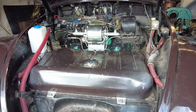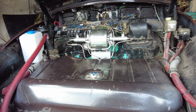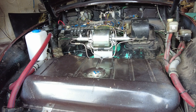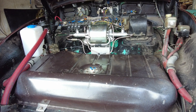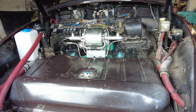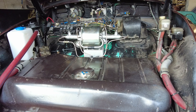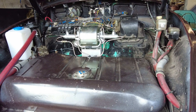We are all back together again. I just jumped in and started it up. We tested we got a vacuum first, which we do, and my foot went straight to the floor - there was absolutely nothing there at all. The full system had been bled using an EasyBleed pressurized kit but for whatever reason it didn't seem to bleed this system properly. So we just re-bled it manually using the foot down, open up, close it up and then foot up technique - the old-fashioned one. We just did it out of the servo, pumped a load of air out which must have been in the master cylinder still, and we've now got a nice firm brake.